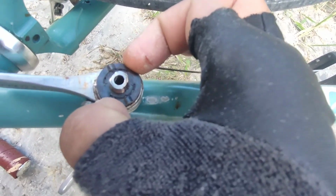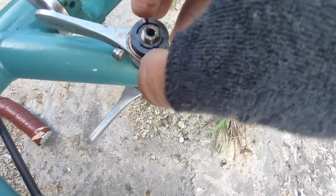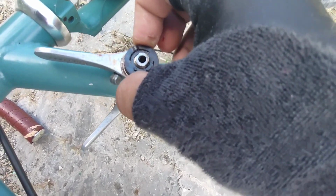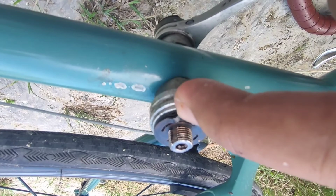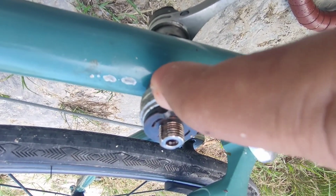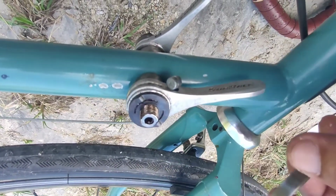This one right here has a lot of grease, I remember, because I really soaked it with grease when I installed it, because I thought adding grease to these parts would help the performance, but I suppose I made a mistake. So now it is clean, but I think the main problem here is that there is no bearing on this side. On the other one, I hope it's clear on the camera, there's a small ball bearing right in there that's been holding it. In here there's none, so probably that's what is keeping its performance so poor.